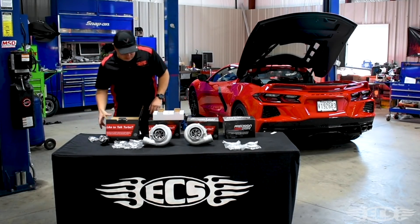The top mount setup would be pretty badass if we get that to work. We have the open window in the back, so it would be nice to be able to look down and see your turbochargers. However, one concern I do have is future models such as the convertibles — all of this will be blocked off with a heat shield. Heat is definitely a concern with that. We will obviously be using exhaust blankets and heat wrap on the turbochargers, as well as working with a couple of outfits that do custom thermal blankets. We'll do a custom blanket for our manifolds, the turbos, and all our exhaust housings, so there's no exposed metal radiating heat in your engine bay. Having them up top would also help with gravity drain — the higher the turbos are, the better it is for your gravity drain. So there are definitely some benefits and some drawbacks, and we'll be looking at all those options as we tear the car apart.